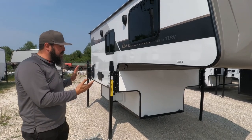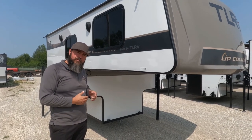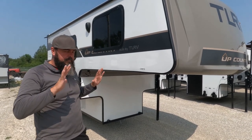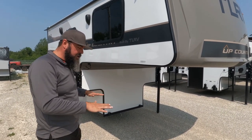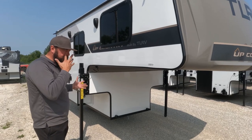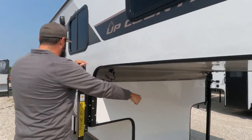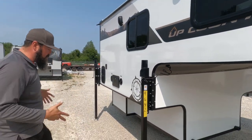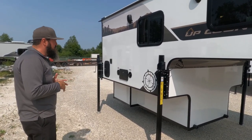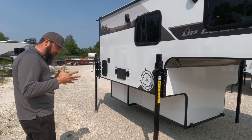We took the side walls and applied what we learned from our Rove Light series. We use an Azdel-back gel coat fiberglass with two-pound fire-retardant foam in between, and Azdel on the inside as well. That's all built as a vacuum bonded structure with a two-part epoxy. Then we Sikaflex-glue the entire unit together, just like we do on our Rove Lights. The T-wall and bunk are now laminated with that honeycomb composite. Sikaflex is the same compound used to glue motorhome caps and roofs on — you could pull the screws out and still have that bond.